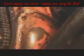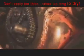Okay, I've got the plate up in here. I'm going to squeeze a little bit of this Right Stuff right up here in this corner just to fill in this gap. This is where the old oil gasket would have been, but I got it all slid in there. I had to work at it, and I got both tabs in there real nice, got the whole seal in, held it down with a couple bolts, a couple more bolts up here holding this whole plate on here.